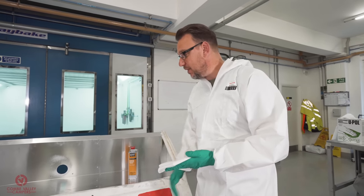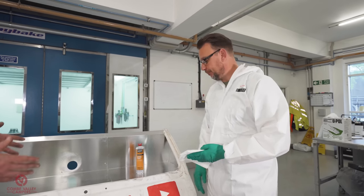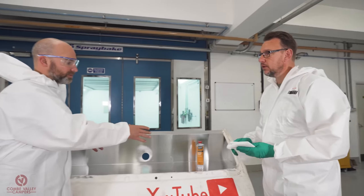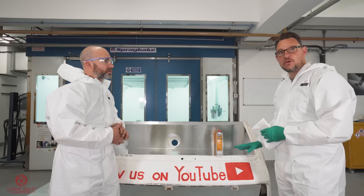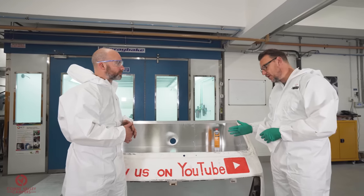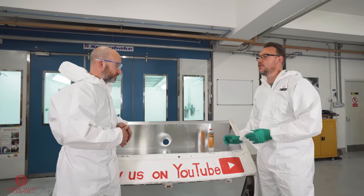Okay. If that happens, we need to sand it off and we start from a sound substrate. Brilliant. And so say if we're doing this from home, this is available anywhere, standard thinners? Standard automotive thinners, any automotive shop, any automotive distribution. Even white spirits will give the same effect. It's just to see if you're re-softening the paintwork that's there already.